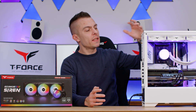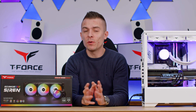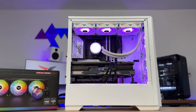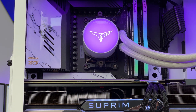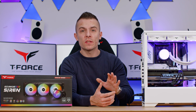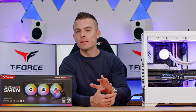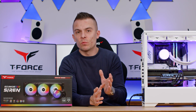The fans create an outtake through the radiator, and we have a 7900X on the motherboard. For the thermal benchmark in AIDA64 Extreme Edition, I ticked CPU, FPU, cache, system memory, and GPU. I also swapped to the RTX 4070 Ti for this test. The RTX 4070 Ti Supreme X stayed at a very good 65 degrees Celsius constantly during the 15–20 minute benchmark. The CPU went up to 79 and had some peaks up to 85 degrees Celsius.